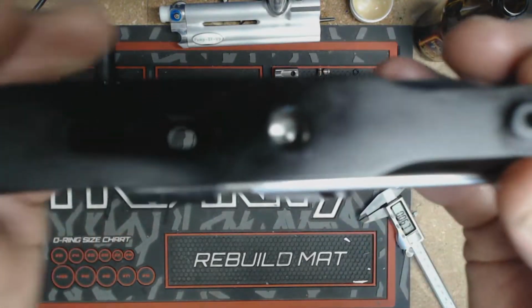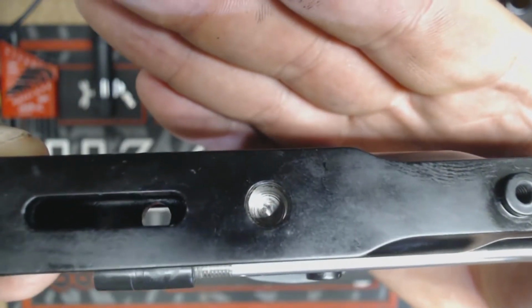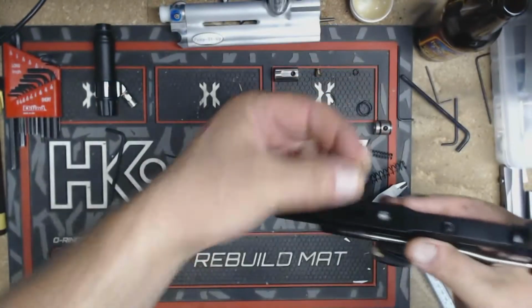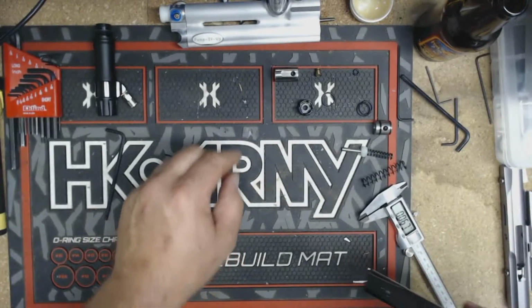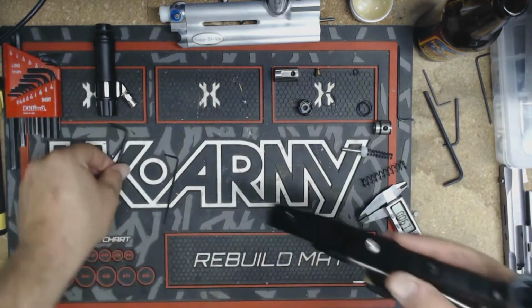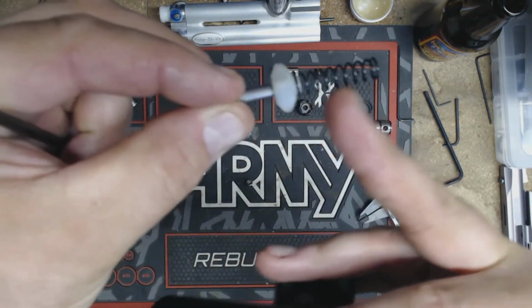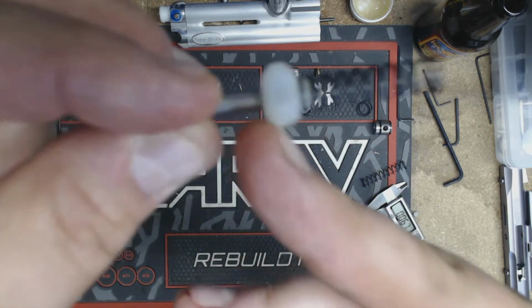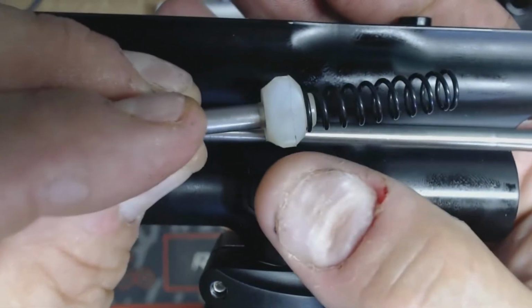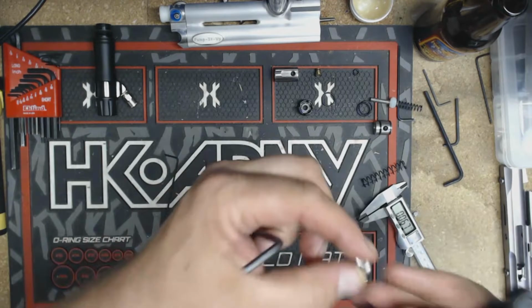All right, I'm back, and I'm going to bring this up in here and try to get everything to focus on it. I put my hand underneath there. There it goes. And see how far it is. And it's interesting. Put this set screw in here. When you put the factory spring in, the spring is compressed more. And in this one, it's not as compressed, and I think it's because on the high flow spring, it uses this same spring, but on the valve face itself, it's not as tall as this. It's much more narrow, so it drops the spring down probably about to right where that little molding line is. I think it probably drops it down about that far. And what that does is it doesn't put as much pressure on that spring.